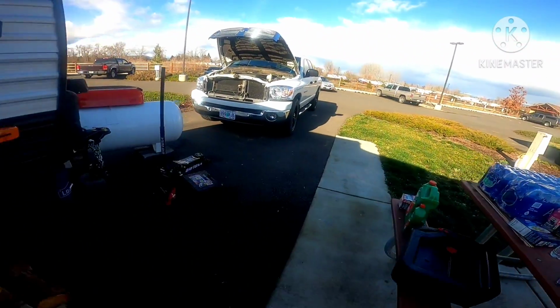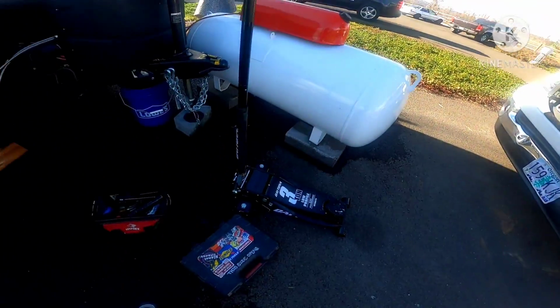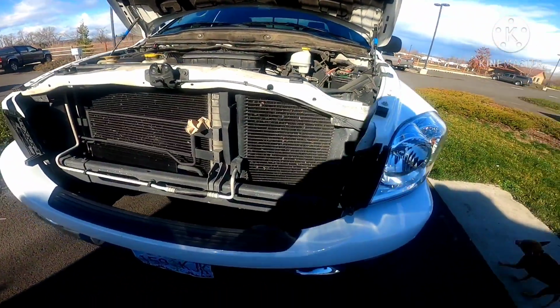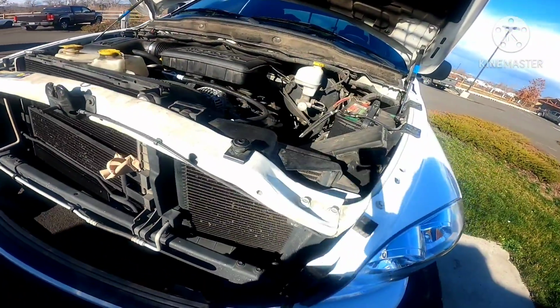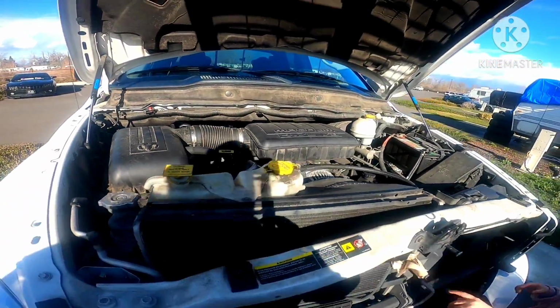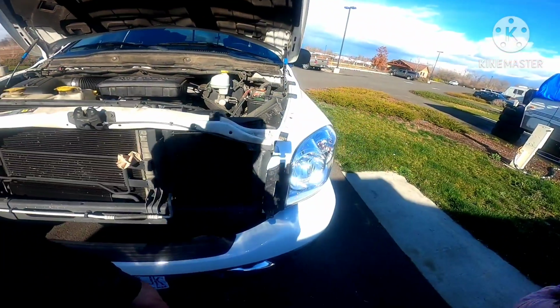And yeah, man, well, I'm gonna get to it. I'm gonna lift this baby up with this jack right here. I'm gonna probably do all the work down there. Like I said, you're gonna need tools to loosen up that bolt, and then afterwards all the fluid will start flushing out. All right, so I'm using a 12mm socket. Usually you will need a pry bar, depending on your vehicle. Pry bars are usually a lot better to use. I already used my pry bar to get this loose. So I'm gonna start getting this baby loose.